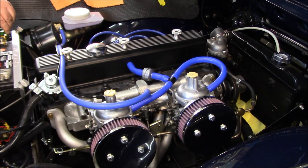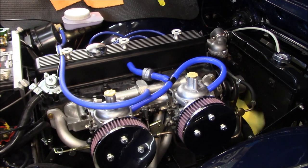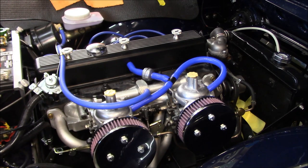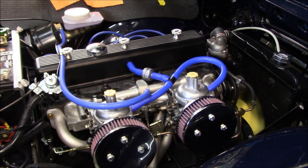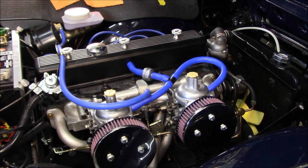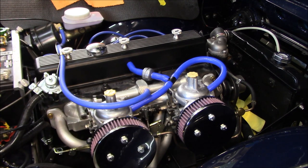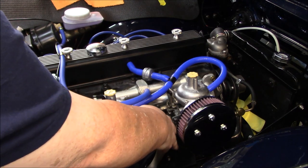Battery on, fingers crossed. Turns out we needed choke. Of course, we're going to have to adjust the timing after putting the electronics in. Let's give her one more shot - I'm going to put the chokes on manually because my chokes are still not hooked up.